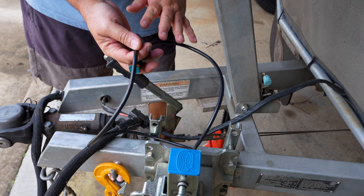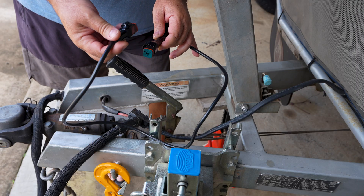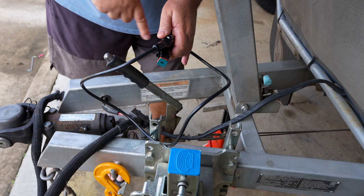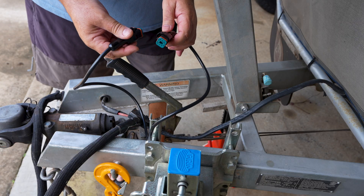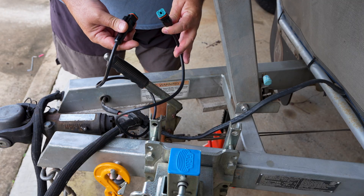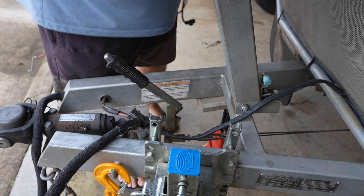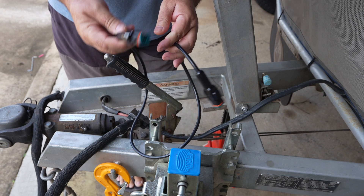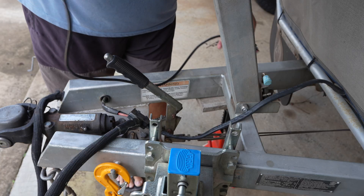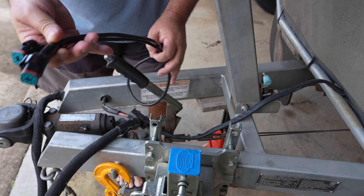You do not get this with the Elec Brakes main controller unit itself. You will need to purchase an optional adapter that will suit your camper trailer to your tow vehicle. In my case it's 7 pin. I can either go here or I can either go there. I've come to the conclusion that this is not long enough from there to here — we're going to be about 100mm short.